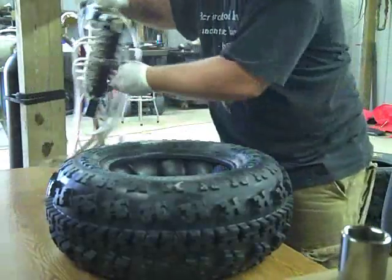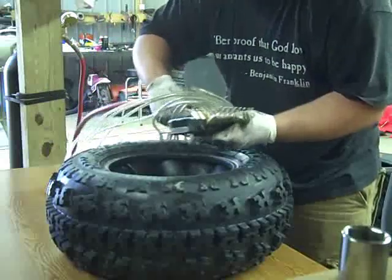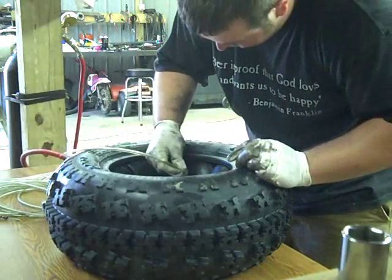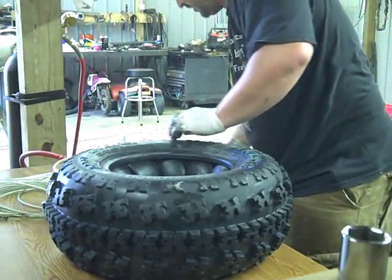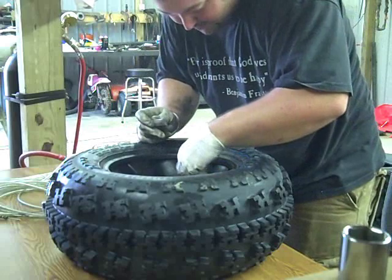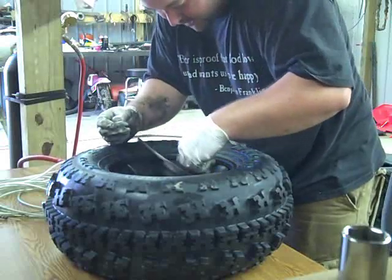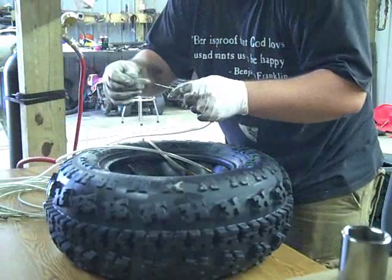And I have one of the tire ball octopuses. These are fantastic, especially if you do a lot of tire balls. I do a lot of tire balls. So, go along through here. Well, get some more silicone that comes with the balls too to dip your needles in. It helps lubricate the valves so your valves don't get stuck or you don't rip them and get a slow leak and all that. Just lubricates the needles.